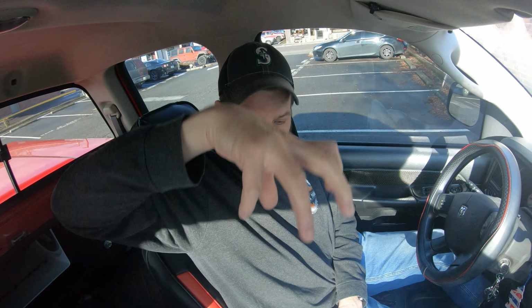So I ended up with two different map sensors. Both were the twist-in kind because that's what my truck took. With the new part, the base was thicker, so when you went to set it in and twist, it hit and wouldn't allow it to move forward. It was also slightly too long. On the 2004, it was thin in the back, so I could make that swing, but it was too long, so it was hitting up front.